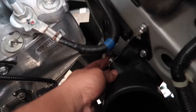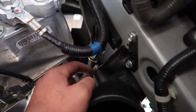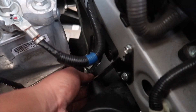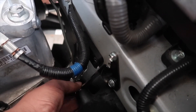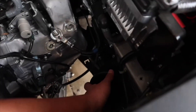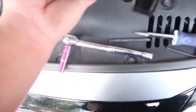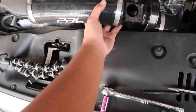That's currently how the bottom part sits — you have two bolts and two bolts holding the elbow piece, and we're going to go back to the top and bolt the elbow piece to the other bracket. Here's the bracket — everything is tight, I just need to tighten it all the way down. I just want to show you that one bolt connects right here and we need to tighten these two down. You want to make sure these are tight because you don't want this wiggling around especially when you're racing. It's better if you just secure it all right now than forget about it later. We're going to tighten that down and after this put the silicone right there on top of the elbow piece. This is how it looks with the silicone connected to the elbow piece — now we just need to tighten that bolt, put in this hosing right here, connect there and here, tighten everything down, and then finally put the cone on.